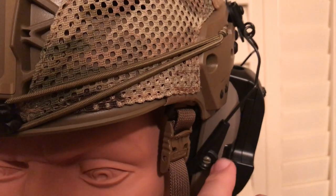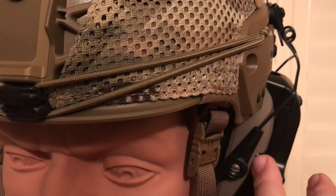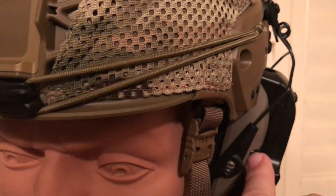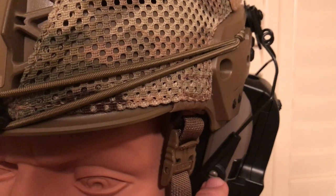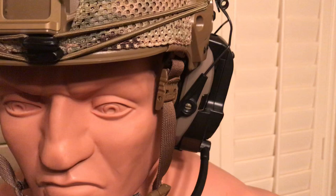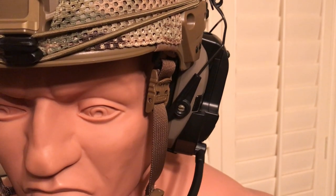When you're taking off the mounts, you want to just gently pry it with a flathead underneath here or here, and that'll keep it from breaking off this little end piece right here. So you definitely want to be gentle with that, or else you end up ruining a set of headphones.